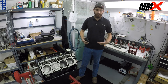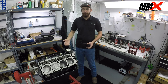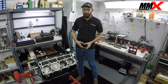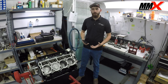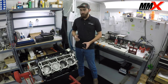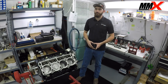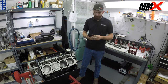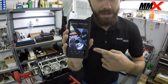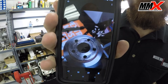That is the main reason that we are taking the time to make this video. There's been a lot of misinformation and a lot of blaming Comp Cams and the camshaft manufacturer, and it's not their fault. It's always associated — when you have a pin failure — with an improper clamping load. We just want to tell you: don't be this guy, because this is what happens when you don't install your camshaft properly.